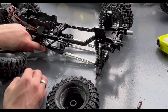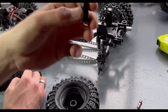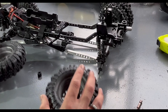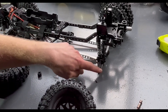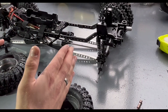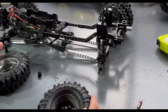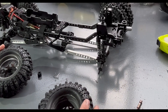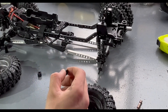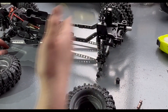The solution was to use the front wheel adapter on the back and the rear wheel adapter on the front, and then run eBay wheel extender hex extenders — you can buy these in loads of different sizes. When I tested them on the truck before changing the adapters, the track was very narrow anyway, so I was already looking at widening the front track width. I've kind of killed two birds with one stone.